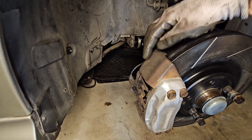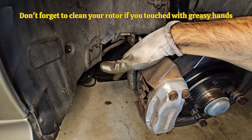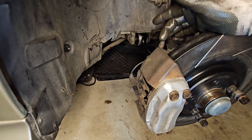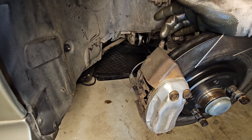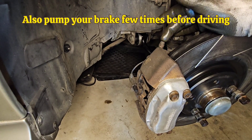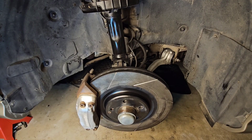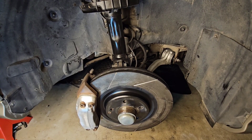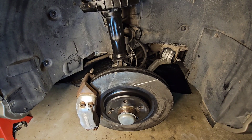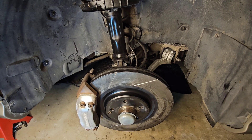While you're here, it's a good idea to check your brake pads, brake sensor, and rotor. Also, if you haven't flushed your brake fluid recently — within the past two years — it's probably a good time to do so. I'll include screenshots from the WIS instructions, as well as the specs for the free play of the bearings for different models.